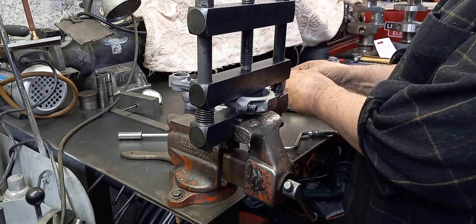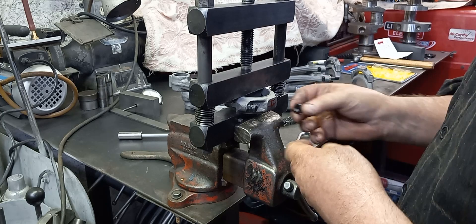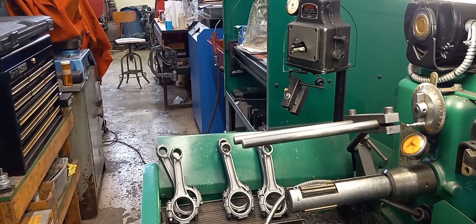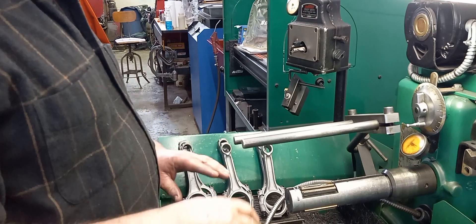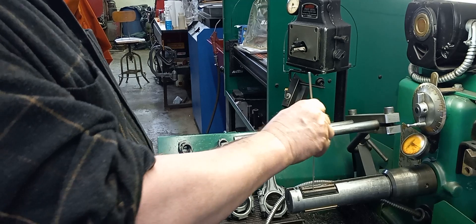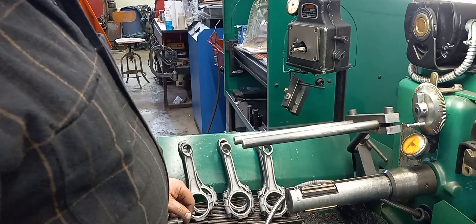When they were frozen, I try not to hit on the big end of the rod — you don't want to spring it. Anyway, we got the rods all together, they're torqued. We checked a few of them for size. I've got my diamonds on my CR mandrel and we're going to rough them in.